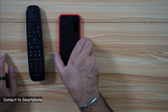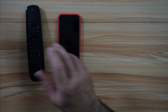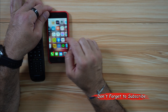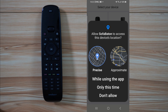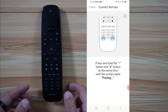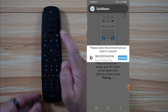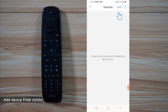The first thing you need to do is to install the application on your smartphone. Depending on your smartphone type — Android or iOS — scan the corresponding QR code and install the application. When you install the application, it will ask you to register. Here I already installed it and registered for an account, and I'm going to launch it now. When you start the application, press on the remote control that you have — so here I have the U2, I'm going to tap on it. It will ask you if you want to use the location, so tap while using the app, then allow Bluetooth and allow once again. Now on the remote control, press and hold the minus and E buttons until the screen says pairing. Now it says pairing — tap on connect on your smartphone. It says successfully connected when it is connected.